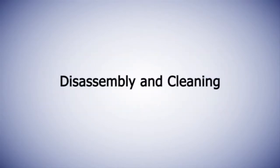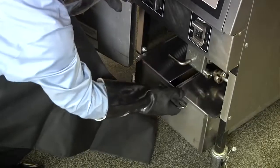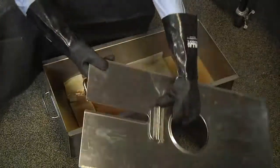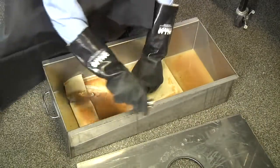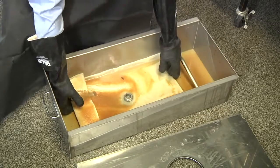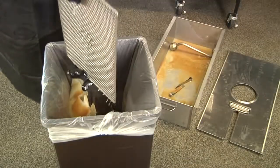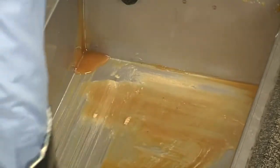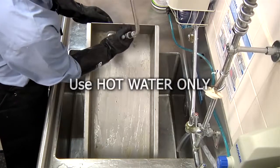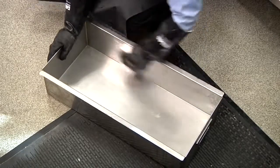For cleanup, after filtering is completed, allow the built-in filter pan to cool down. When the filter pan can be handled safely, disconnect the filter union and slide the filter pan from the cabinet. Remove the cover. Unscrew the filter pan assembly. Lift the filter assembly. Remove the filter paper envelope and discard. Wipe out any sediments remaining in the filter pan. Rinse out the filter pan and all parts using hot water only. Wipe filter pan dry with a clean towel and allow all the parts and filter pan to air dry overnight.